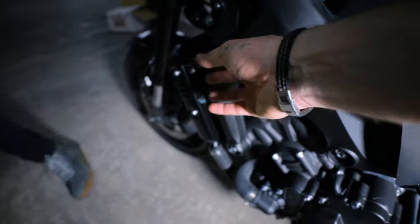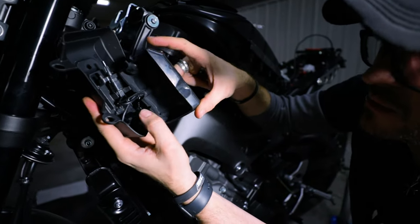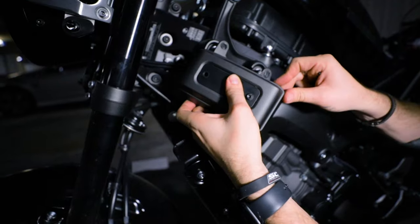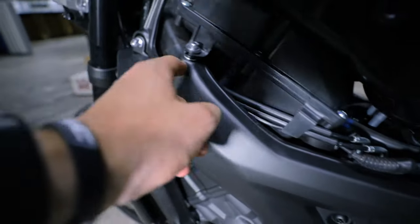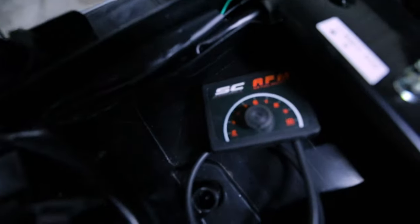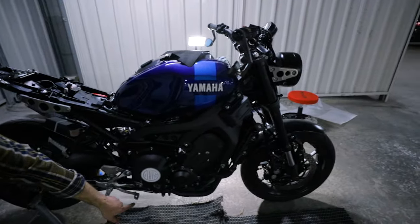Pretty easy. We just put the airflow meter back in, plug the harness in with the two plugs — managed to get both plugs in there. Everything seems nice and clear. Look at that — the airflow meter is in there, the plug for it is just sitting there, everything's cable-tied nicely, no moving parts on metal. It runs up here and it's nice and tidy. You've done the left-hand side springs — now tighten this clamp and the headers, then the top springs and the tank.